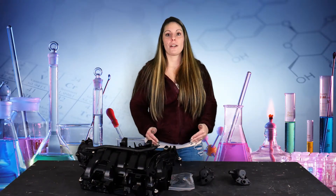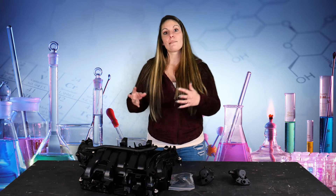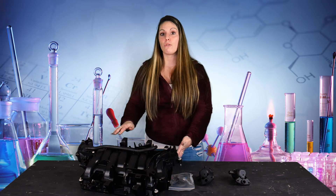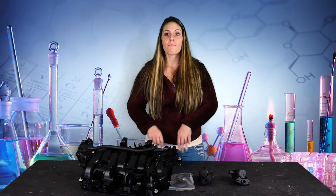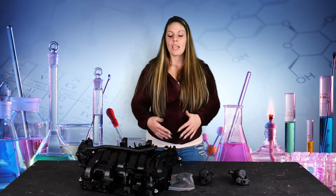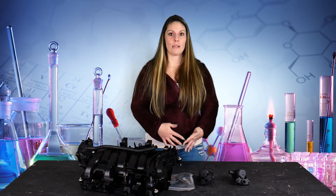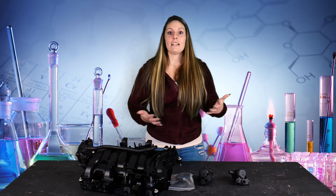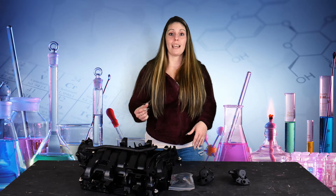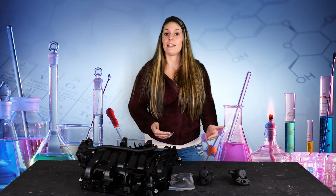This engine does have very high operating temperatures. So when this plastic heats up and expands, those little tiny chunks will actually become embedded into the plastic of the manifold. You turn your car off, later it contracts and they're stuck in there. Now you purchase an engine and go to just switch this intake manifold over — it's going to heat up again. And when that plastic expands, those pieces are going to become loose and then be drawn into your brand new engine upon startup and cause an at-install failure.